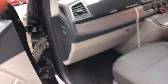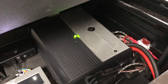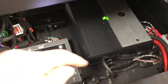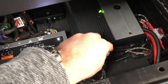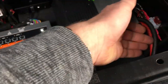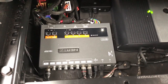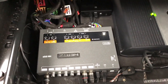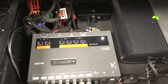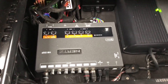Moving around to the back of the vehicle — the powerhouse. We undo this panel and we can see the JL Audio 3-channel Class D amplifier, which runs the front speakers and the under-seat subwoofer. It's mounted on an MDF panel, so there's no drilling to the vehicle whatsoever. We've used Connection best phono cables, our favourite interconnects, and Stinger power cabling. We've used the H8 DSP — the Hertz digital processor — which now replaces the Audison Bit10D in all of our installs. The Bit10D is unfortunately discontinued, but the Hertz H8 is a very similar product and a great replacement.